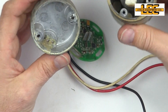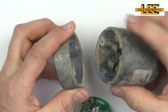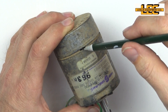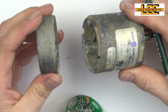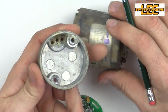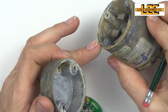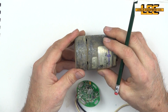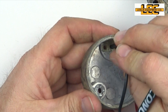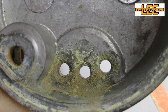If you'll notice the bottom here, there are a couple of things you should pay attention to before installing these. When you put them together, there's a hole in here that allows moisture and atmosphere in. Some engineer said it's a good idea to let water get out — but the bad thing is, it also lets water get in. This is also not a hermetically sealed closure. The wires don't really provide any type of seal at all because they just slide through there. You can tell by looking that there's been some corrosion activity in here as well.